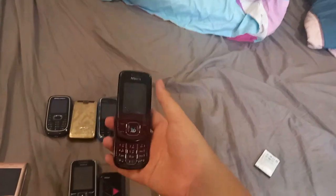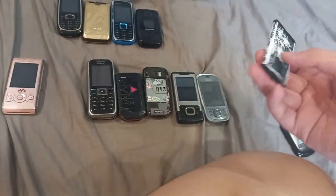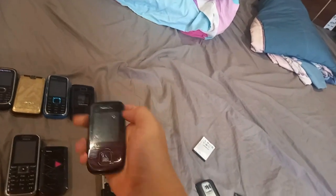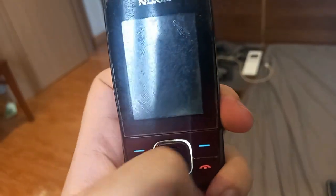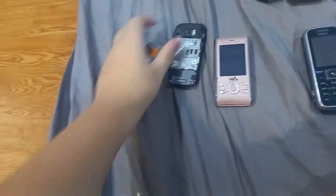As for the other three — you can't win everything. This is the Nokia 3600S. I don't have the right BL4S battery for it, so I pulled out a BL5J and tested it by holding it in a weird position. At first I thought only the screen was the problem, but none of the buttons wanted to respond — I'm going to assume it's a flex cable issue. Not really worth fixing, but I only paid $1 for it.